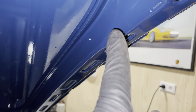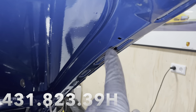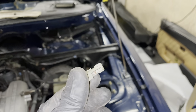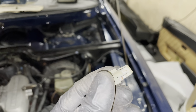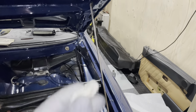The first thing I want to install is this little grip that holds the Uppie bar onto the bonnet so it doesn't flap around when the bonnet is closed. If you search for the part number online you'll find all kinds of plastic stuff — but this should be metal. I couldn't find it anywhere until I tried Porsche themselves, and they still sell it. Do not buy the plastic junk, it will break. Go to your Porsche dealer and get this clip. It was about five bucks, so it's worth it.